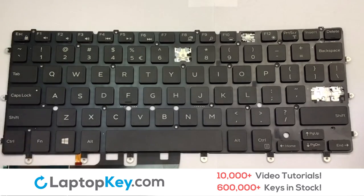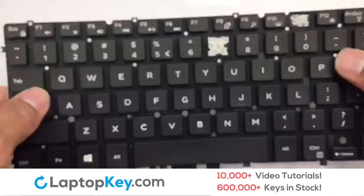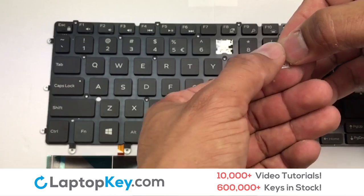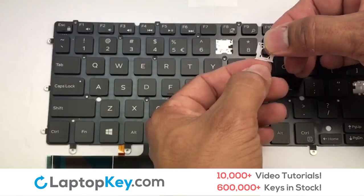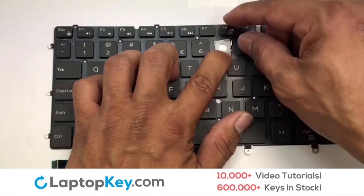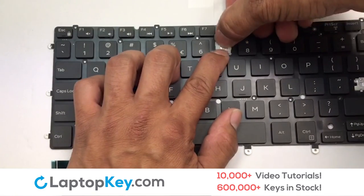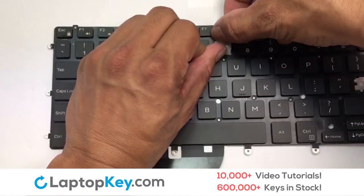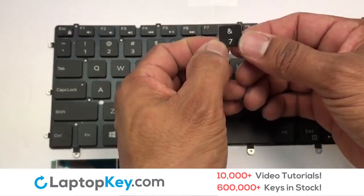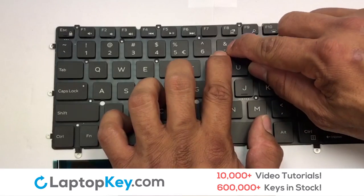We're going to show you how to install your laptop key. Let's install the regular size key. Feel the surface of the retainer clips — the smooth surface on the clips should be facing upwards. Press the retainer clips downwards so that they attach to the metal hooks on the keyboard. Apply pressure to the upper tabs so that the key retainer catches onto the metal hooks. Place the rubber cup in the center, then place your keyboard key on top of the retainer clips and press down to attach the key.